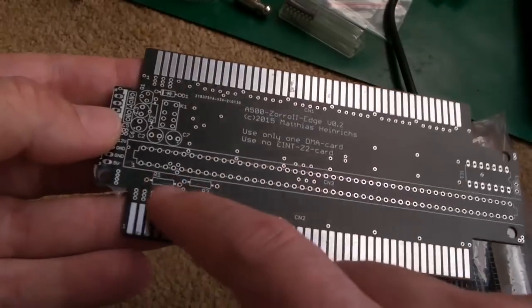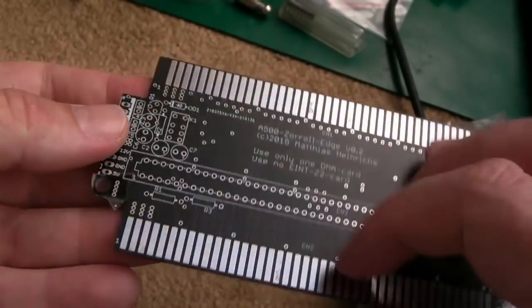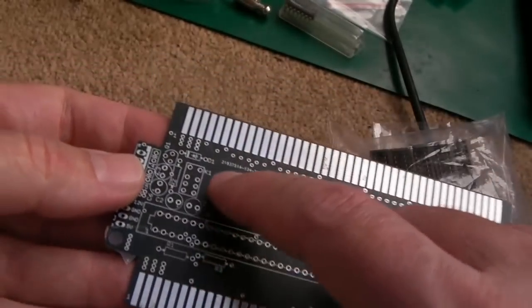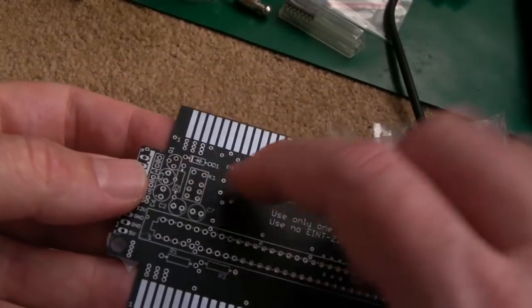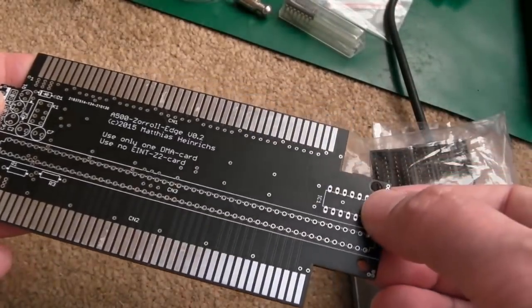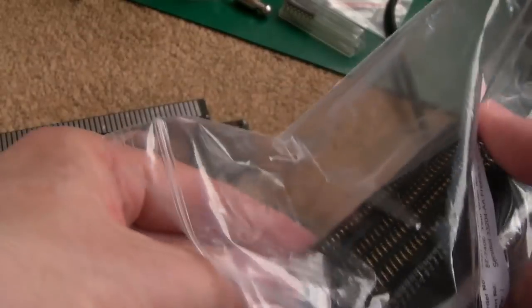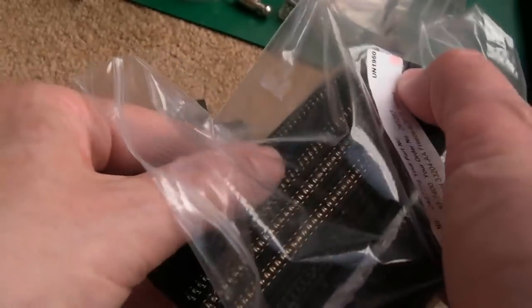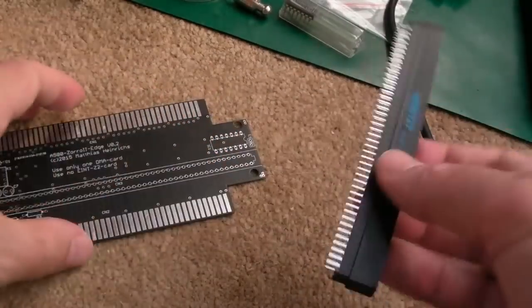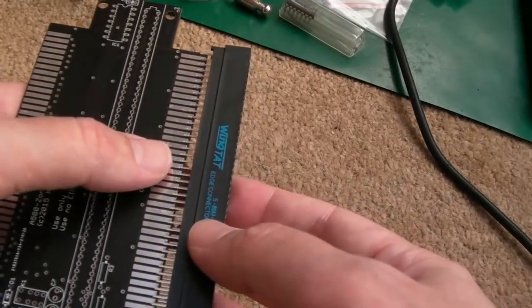I just need to do some connectivity tests on these resistors to see where those go. They may just be pull-ups or pull-downs, and also that diode there, I'd like to check what it is doing, but I am guessing we can literally just install the chip, install the 2 sockets, and we are done. So these sockets here, the ones for the Amiga side, going to the A500, you need 86 pin. These are available on AliExpress.